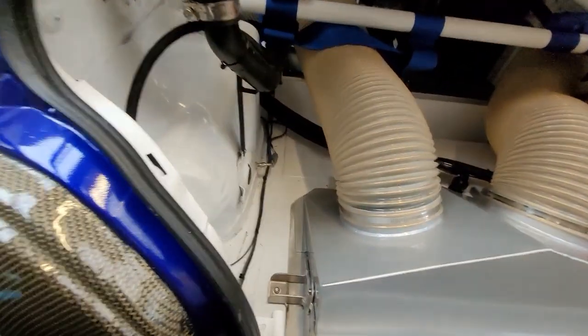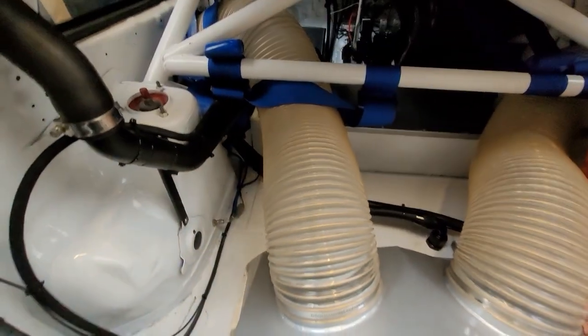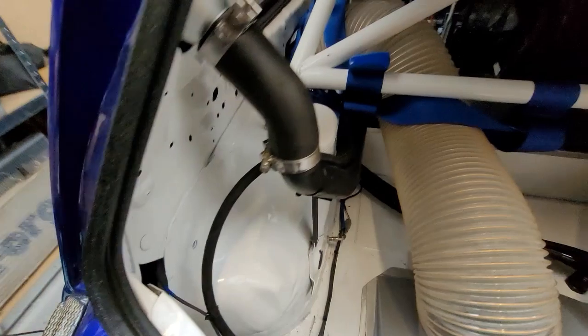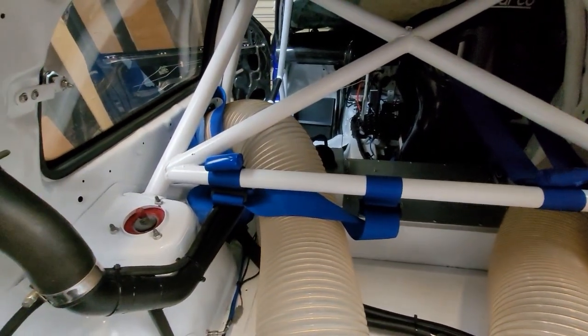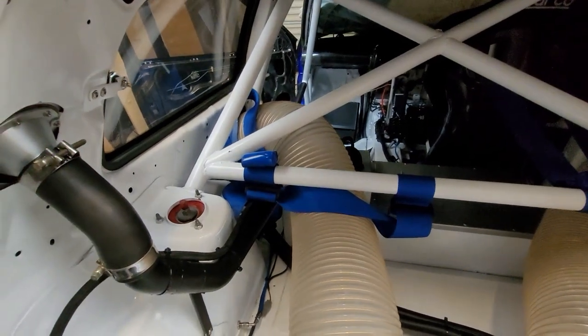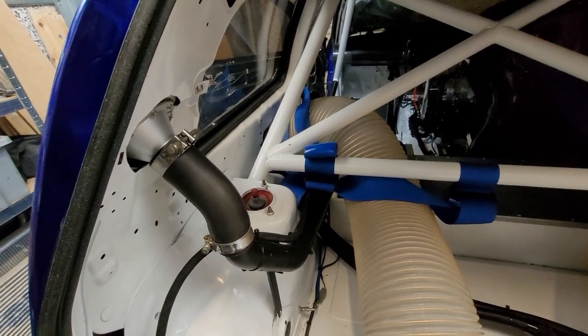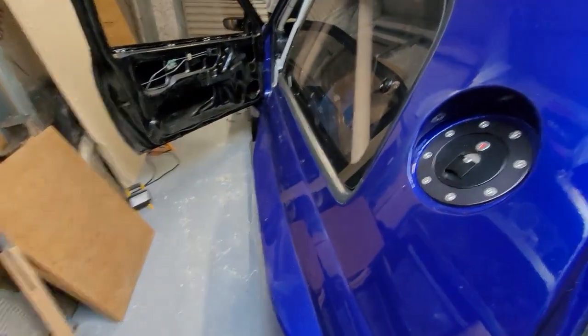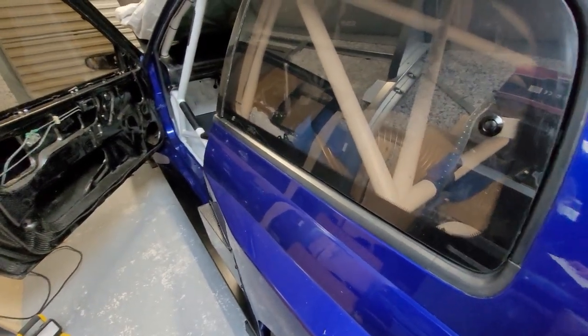So the first thing was, there are two leaks in the back radiator. There's a leak somewhere here, and there's a leak somewhere at that fitting. Then there's a fuel leak. I think it's the aluminium washers in the fuel tank, so I'll need to change them to copper washers. I'll need to take the engine out. There's a big pipe that goes in the back of the block that's leaking. I'll tidy up the rear loom at the back of the engine while that's out.